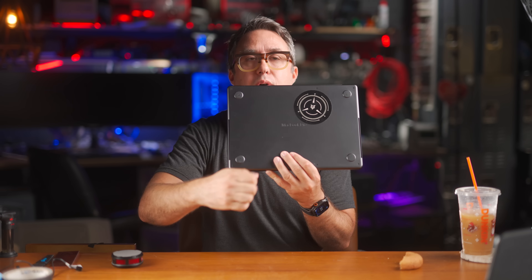Putting these thermal pads in here does not automatically void your warranty — although if you mess anything up while taking the cover off, that probably does. Once you get all these screws off, there are two snap button things you have to pop up, then the case has to slide down before you pull it out. Unlike with the MacBook Air where doing this mod bumps performance by like 30%, on the MacBook Pro it really only gives you maybe 8 to 10% measurable difference in performance, and that's only for the amount of time it takes for these fans to spin up, which is strangely slow for a pro device. Overall I think this is worth doing. This isn't overclocking in the traditional sense — I'm not programming the computer to run faster than it was designed to. I'm altering the conditions it's running in such that it, on its own accord, just decides to run faster while remaining in spec for its heat tolerances. This is a safe thing to do to your MacBook Pro. There are links in the description for all the materials I used.